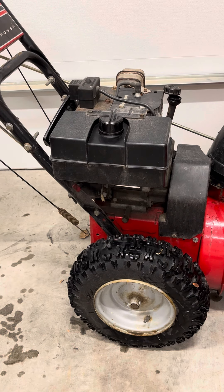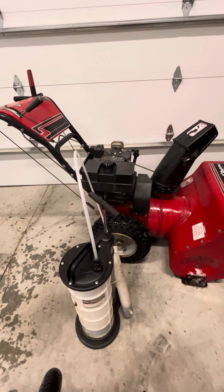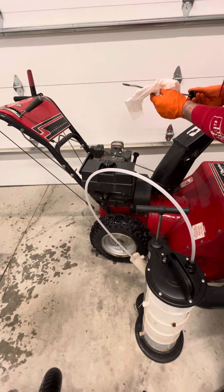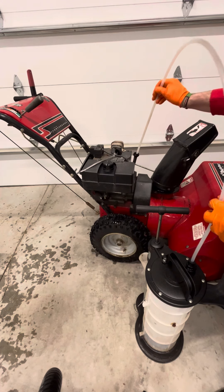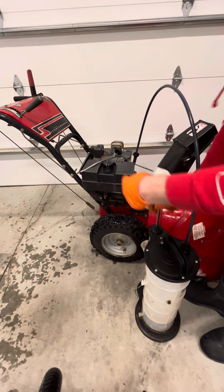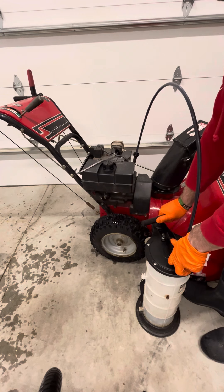For those of you that are going to be doing this full-time as a job or doing it on the side, you want to get one of these — this is the fluid extractor pump. These make your life super easy. Go ahead and grab your rag. Take your fluid extractor tube and send it down right here. Go very slow until you feel it come to the bottom, then just start pumping. As you can see, the oil is coming up and out of that engine. Super easy. When you're taking it out the first way, there is a chance and potential for a mess. With this, it is so nice and slick — you just pump that oil out of there and you have little to no mess.